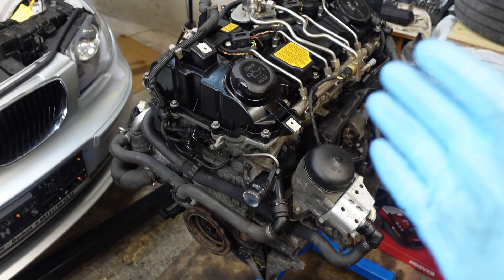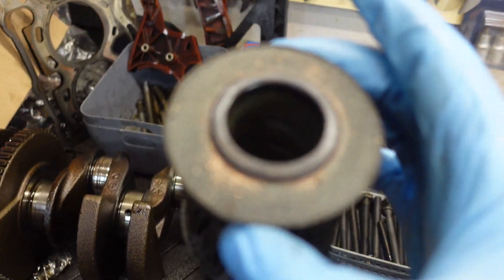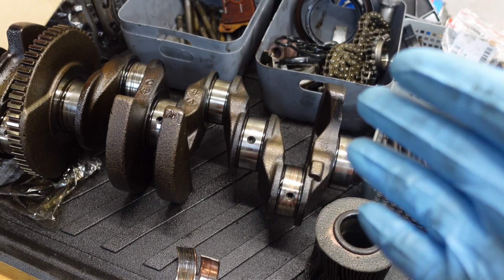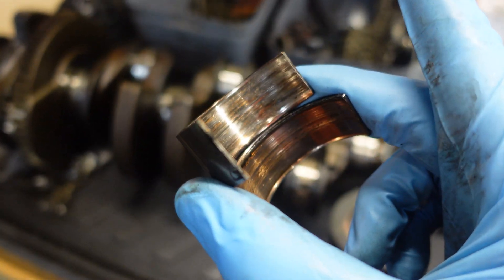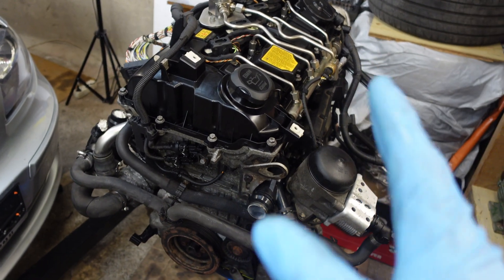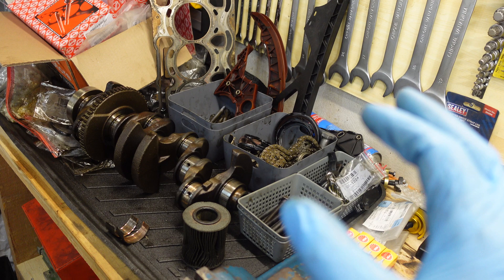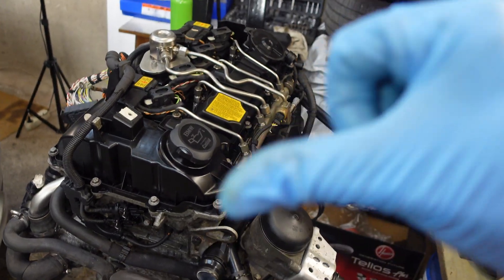It's BeamerZen with another video. This time I will be installing this BMW N43 engine back into the car. I got this car a while ago with some engine issues and after diagnosing I found plenty of bearing material inside the oil. The oil filter had holes inside, which was a pretty bad sign. I pulled the engine out, did a full teardown, and found three spun conrod bearings, so the engine was done. Used engines were really expensive or unavailable, so I decided to rebuild this one. I've replaced the crankshaft, the conrods, and a bunch of parts — I have a detailed video series on rebuilding the BMW N43 engine, linked in the description. But enough talking, let's get this engine back into the car.